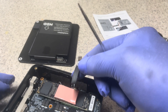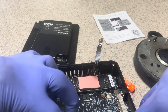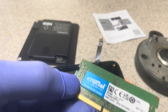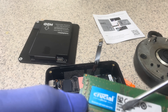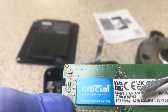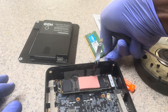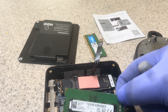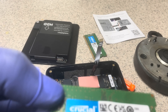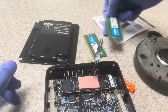Now we look at the inside. Here are the RAM sticks. Before removing the motherboard, let's get the memory out. Click on the side clips and the memory pops up. Take a closer look — mine says 8GB DDR4 3200. So this is an 8GB stick. Because of dual channel, you need two of them to take advantage of the motherboard's dual channel support. Remove the second one — it's also Crucial brand, 8GB DDR4 3200.